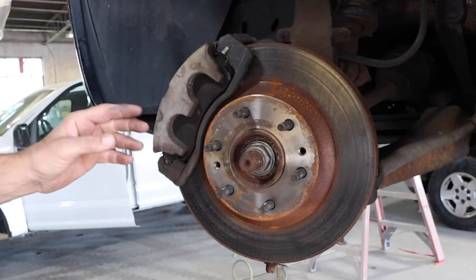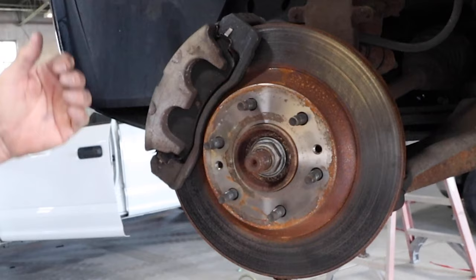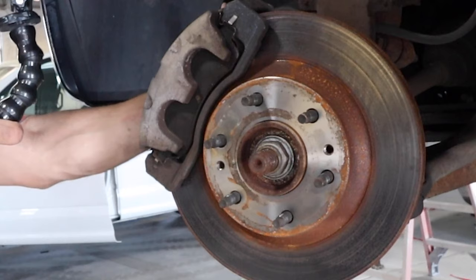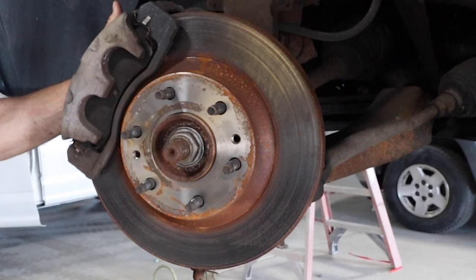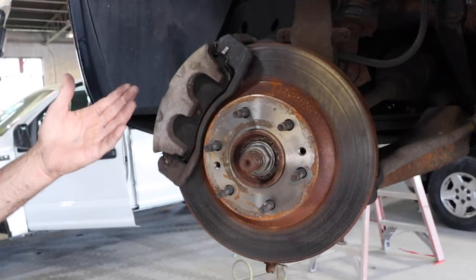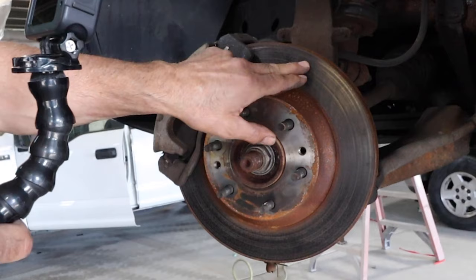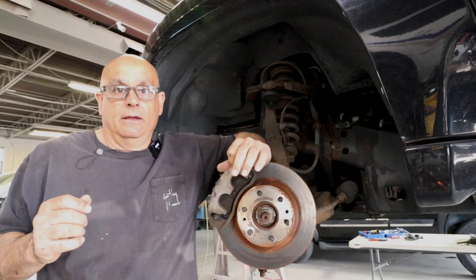If you take a look, you can see he only went back with new pads — he left the old calipers, the old brake lines, and the old rotors. My recommendation is to replace everything as a complete unit, and we're going to do left and right — you do everything in pairs. My reasoning for replacing the brake lines is the fluid has to travel back and forth as you apply and release the brake. If you look at this brake line, you can definitely see it's old and rusted and very hard, so that could be another reason why the caliper is not working correctly. We're going to put new brake pads on as well simply because they've been overheated — when that happens you get extra noise and they don't last as long. The rotors have been overheated too — you can see hot spots and it's most likely warped, which will give you a vibration when you apply the brake at high speeds. We're going to get everything replaced and then test drive it.